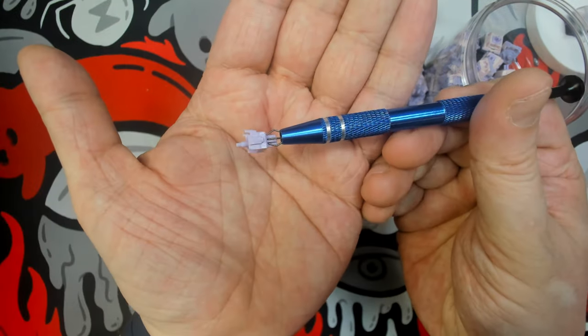All right, so we've got the specifications out of the way. Now, how does it perform? Well, I've got to say, for a linear switch, I, like many others, like long pull. I'm not one for anemic bottom out switches. If I have to press hard to barely get a bottom out, it's just not that satisfying. I found early on that even 2/10 of a millimeter of long pull is satisfying to me. Though there are some stems that are long pull, but still don't seem to deliver that proper bottom out. But I think it probably has to do with the design of their bottom cases.